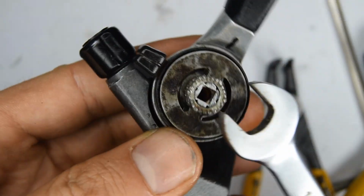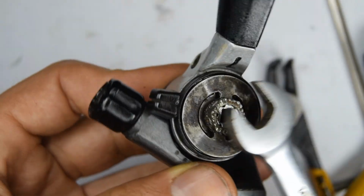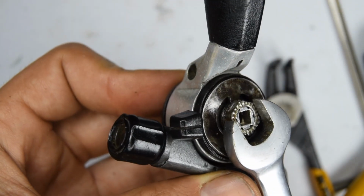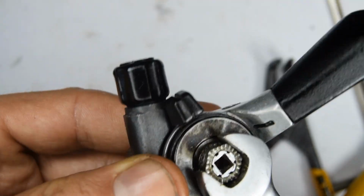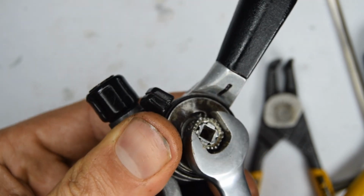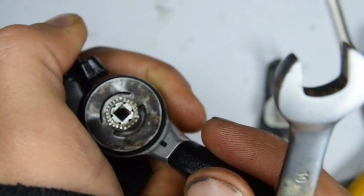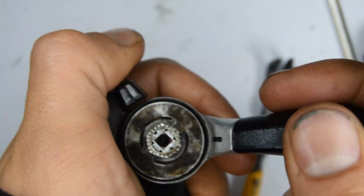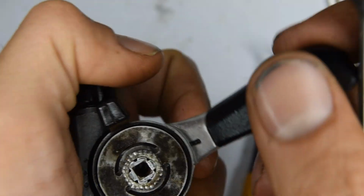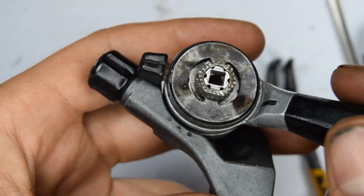Grab your number 10 wrench and start to turn it. So you're going to want this tight but not too tight. Be very careful, you can break the main axle. So you can test this. Let me check now. So there you go, it's kind of clicking, but see it's going up, so maybe just a tiny bit more. You want it to be staying in place, put simply.